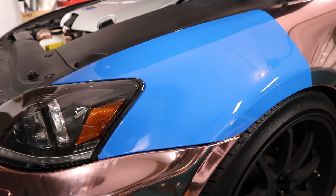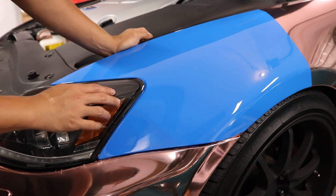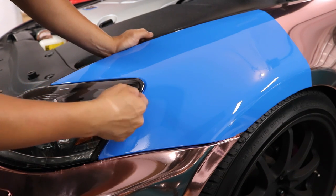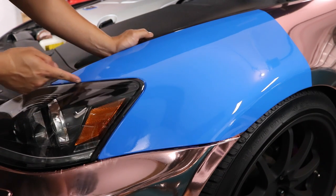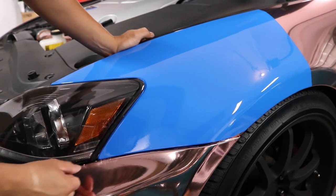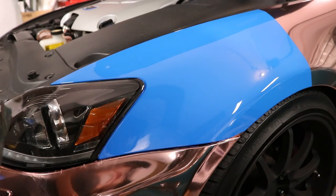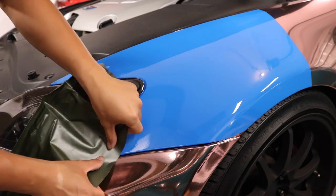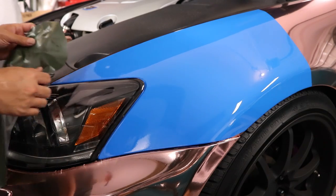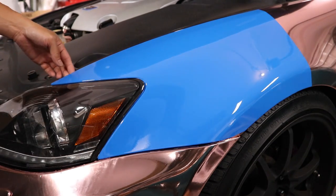There's another look at the fender — looking phenomenal. The key is you don't want to put too much vinyl tucked on this edge. You want to get about a quarter inch all the way around. My headlight does pop out a little bit, so if you were to trim right on the edge — top and bottom — you can tuck that vinyl in and have full coverage, no problem. Same here: a quarter inch and you should be able to tuck that in nicely. Sometimes if you want and you're not in a rush, take a piece of vinyl, lay it there, and just practice wrapping around those edges to get it right and get it down packed. But for the most part, it's looking pretty damn good.